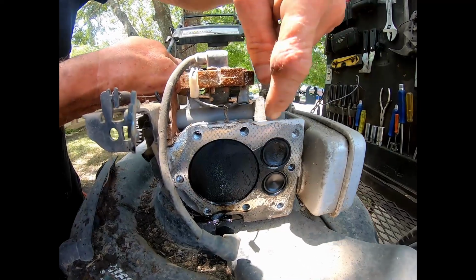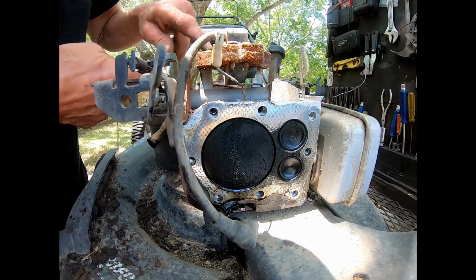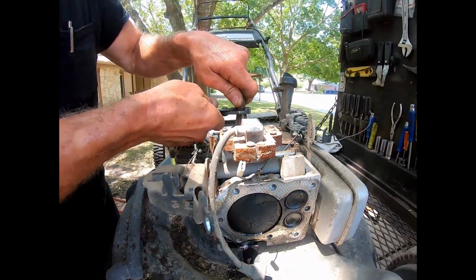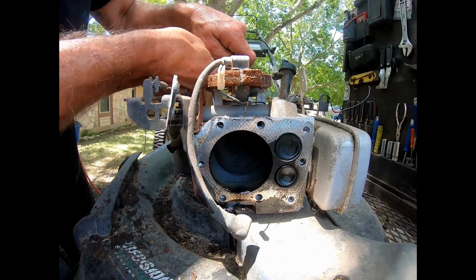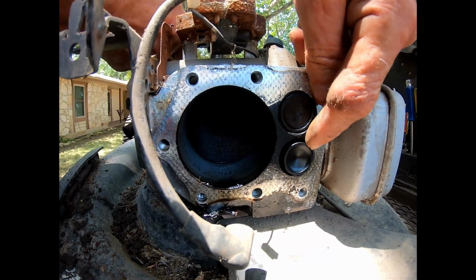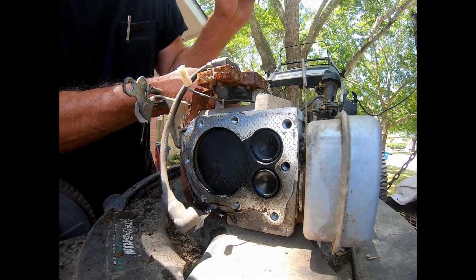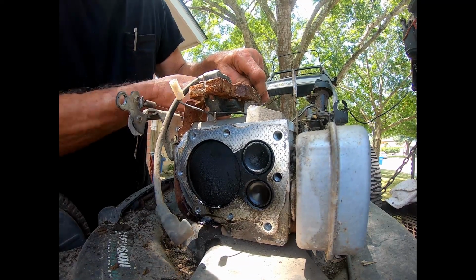So in other words, it just sucked gas in and compressed it. It's top dead center. You see the key is here, so it's in the firing position, and it fires the air fuel mixture down, the piston goes, and boom, that's power. Now you see this exhaust valve opening, up comes the piston, the burned air fuel mixture is now going out your muffler. So that's intake, power, exhaust. Shoot, okay, here you go, intake.